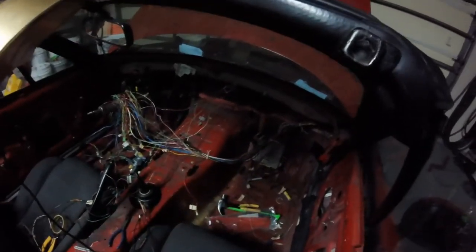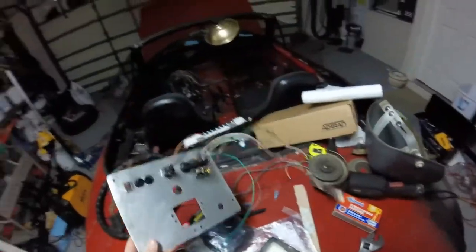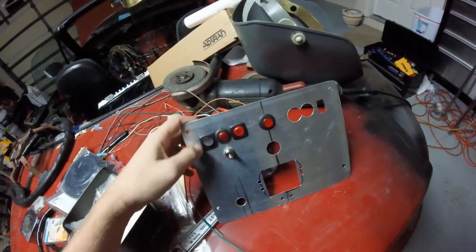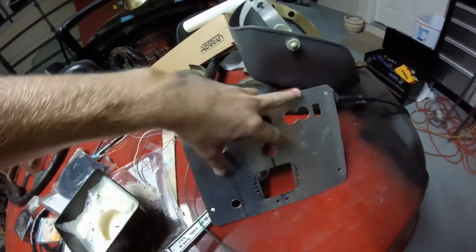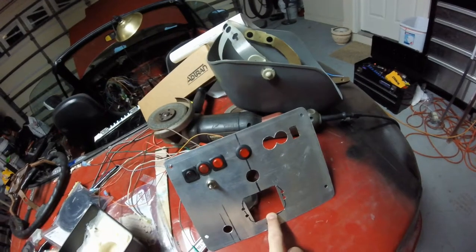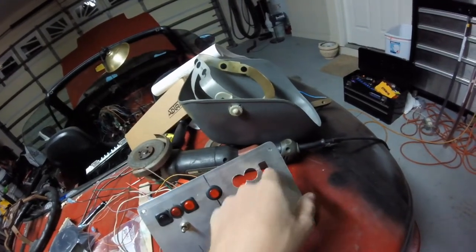So now I'm in the process of putting the wiring back together. I have it just twist-tied there for now, but I'm going to wrap it in loom and get everything back together. Then I'm going to finish the switch panel. I started the switch panel here — it's pretty rough, but whatever, it's just a garbage car. I have parking lights, low beams, high beams, hazards, and a turn signal for left and right. I also have to put a fan override switch, an interior light switch, and zip-tie the power window switch in here.